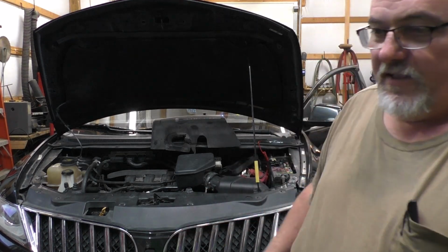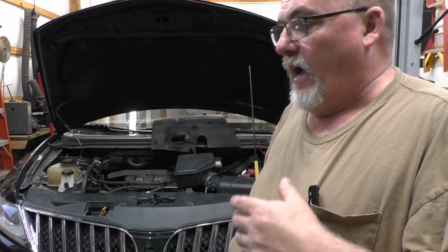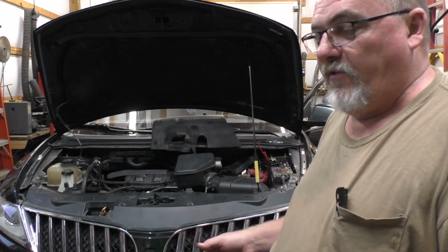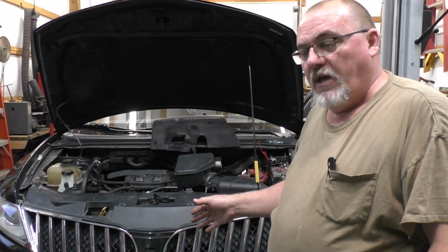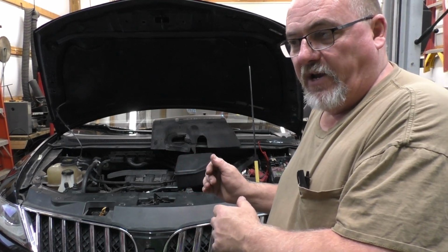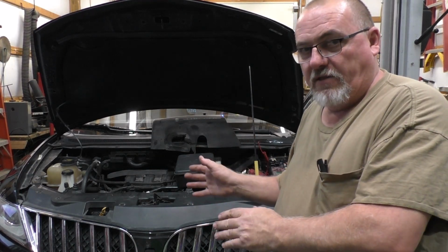But anyway, after I found that, I knew this was going to turn into a rather quick video. I was just going to bring you along. If you have that problem with all the codes that I just listed, basically, check your fuses. Check that first, and don't be surprised if that fuse blows, because something is obviously making it blow. Something's drawing too much current, and that may be the case here. We may have to further investigate, but for right now, to save the customer some money, I'm just going to send them on their way and see if this is going to happen again.